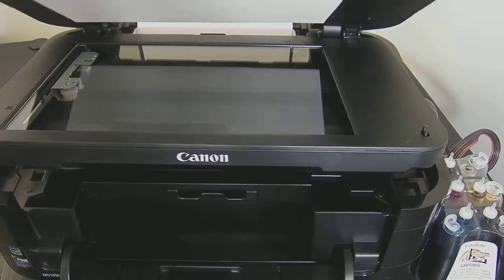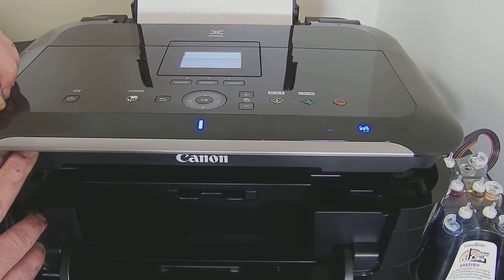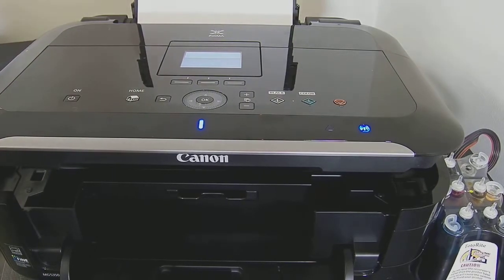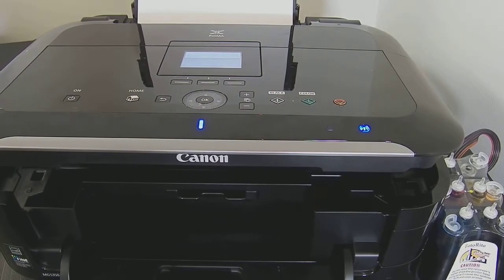While it's doing the alignment you can still use all the functions of this printer — the scan functions and all the other facilities — even with the lid open, because we've bypassed the printer lid sensor and the lid is only slightly ajar, about an inch. Please don't try to close the lid fully, because when you close it fully you'll drop the ink line inside the printer and it could hit the bottom of the tray and cause damage. It's quite important that you run the continuous ink system with the lid slightly open.